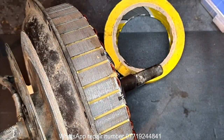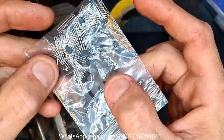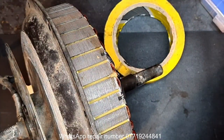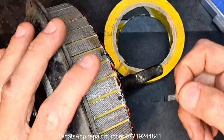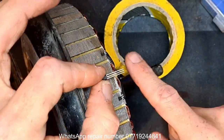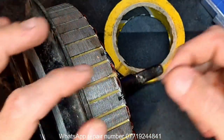Old ones out. New sensors. These are off Amazon. Pack of 40, $9.99. They're generic bipolar. I don't think these are Honeywell. But they are bipolar switching sensors. And this is just going to go straight back in that gap. Obviously, we're going to suit it up, put some heat shrink on the legs, cut it to length, sort out our cables on this side ready so we can solder it straight onto, etc.